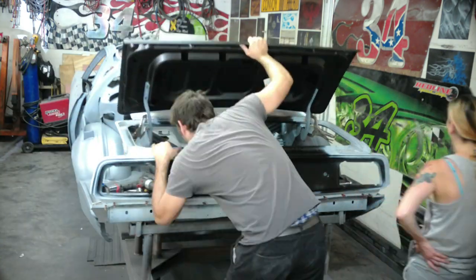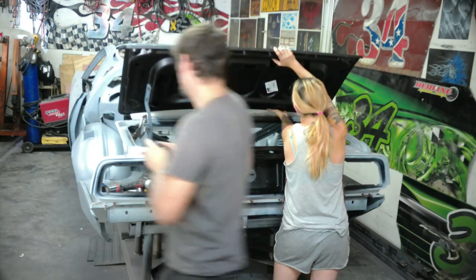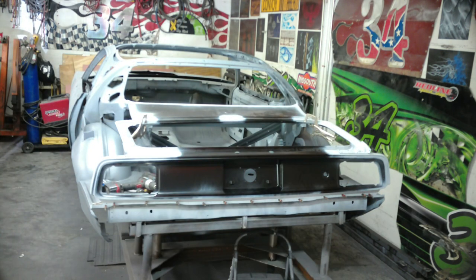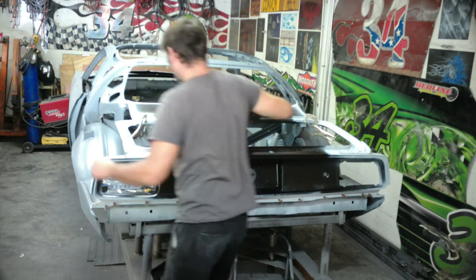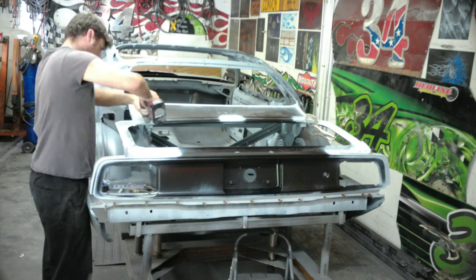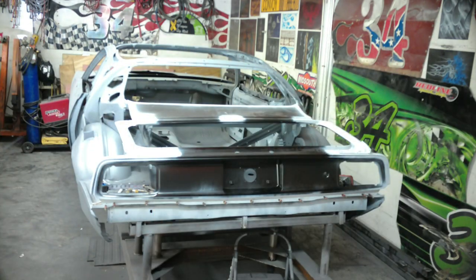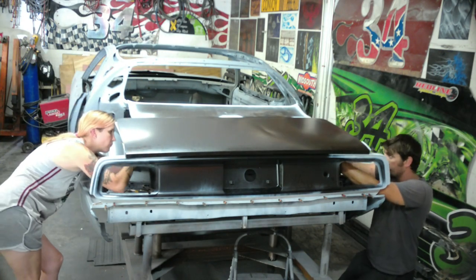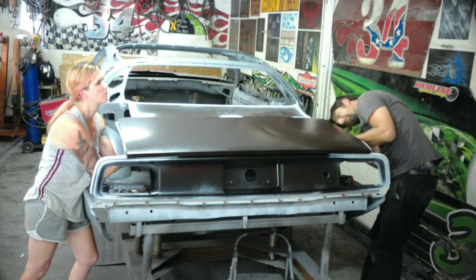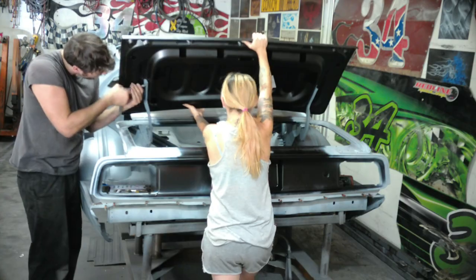We're adjusting those trunk hinge brackets — side to side — since nothing's welded on, we can center everything and make sure left and right it fits. With this car together we don't need any shims and the gaps are going to be perfect. We had to pull the trunk off because one bracket was so far off it was actually hitting. So this is round two on the trunk. Things are going to go on and off plenty of times — that's the key to not welding anything and just clamping everything.